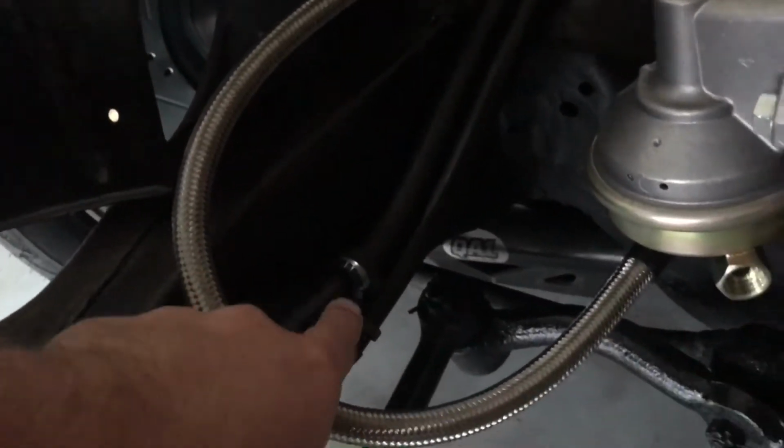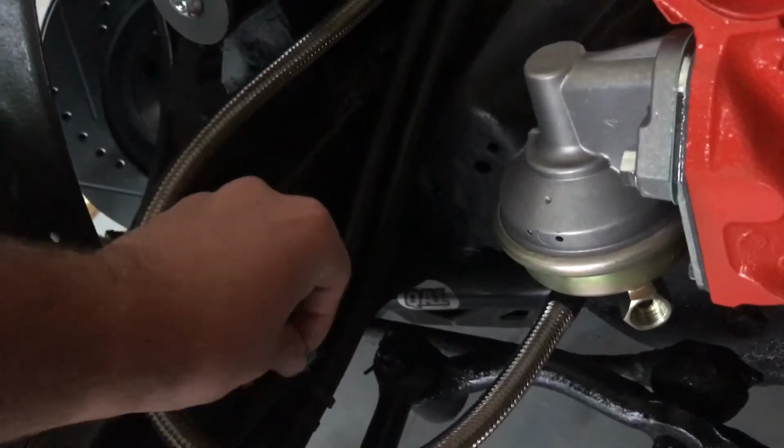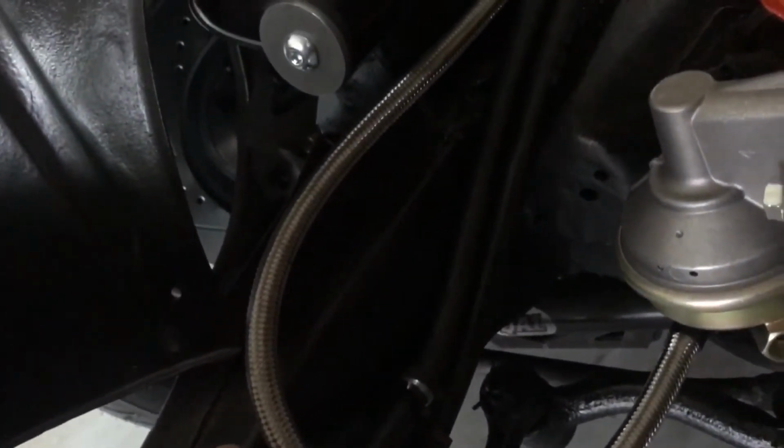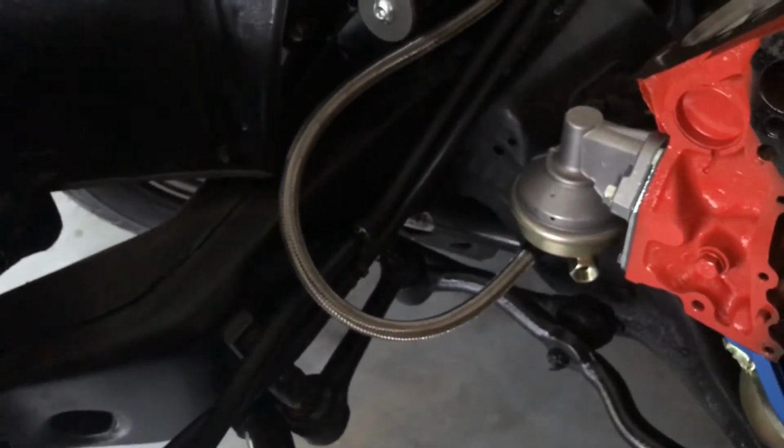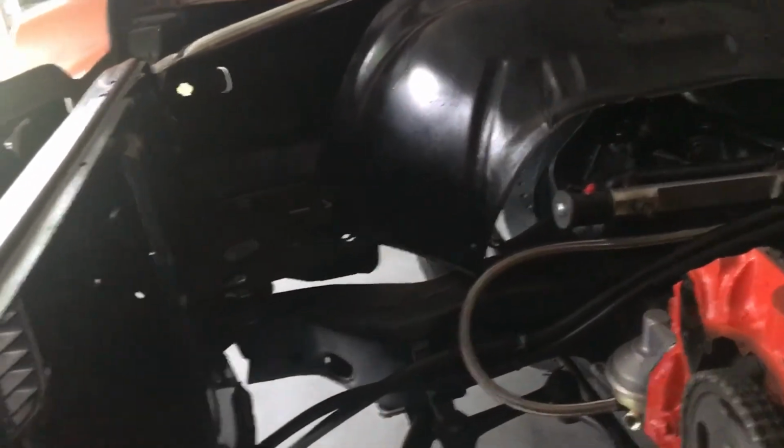And then down here, what I'm assuming was a fuel mount bolt, I guess that's what you call it, I attached the trans cooler lines to that, and then pretty much probably just gonna have to run them under here, because it doesn't exactly fit unless I wanted to drill some holes in my core support right there. That's about the only place that they can go. So we'll see when we get the radiator in and all that how it's gonna fit.